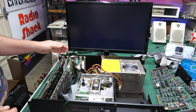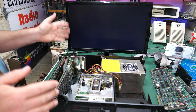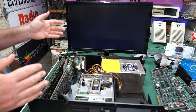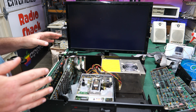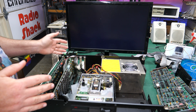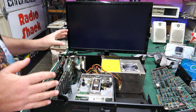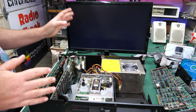Okay, well, I've set up a composite link to a different RGB to HDMI, and I have it set up for Apple II mode. Should be a kind of color composite with NTSC artifacting on. There are other modes you can set up, but hopefully this one will at least let us see if this is working or not. It may not be completely accurate on the screen first shot out of the gate. I might have to tinker with it, but hopefully we should see something.